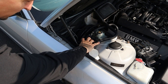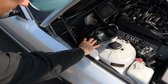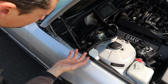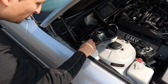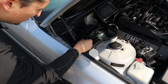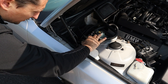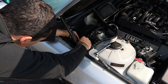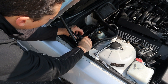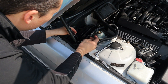This is the location of the pre-charge pump. My car has a right-sided steering wheel and my pump is on the right hand side. It's connected with two brake lines and one electrical connector which is very easy to disconnect — it just slides on this rail here. There are a couple of clips at the back, so just push on these and then pull it out. So this is the electrical side of things disconnected.